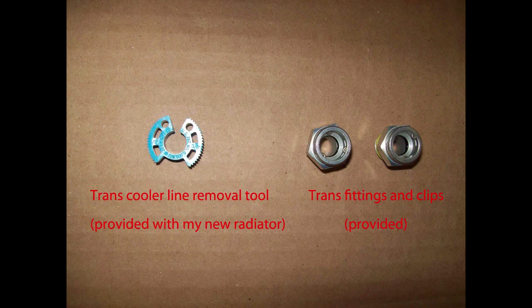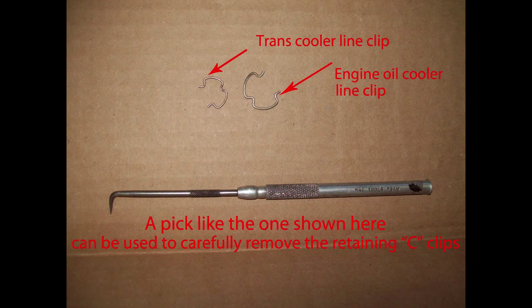You can see the three little ears on these snap rings that retain the transmission cooler line, and you can also see the black O-ring inside the fitting. To install the line, you just push it directly into the fitting until you hear a little snap. Use a light and a dental mirror to make sure that those ears on the clip are holding the cooler line and that it's all the way in. I actually found it easier to use a little pick to remove those snap rings rather than the tool — it just seems to work better. Just make sure you don't bend those snap rings in removing them.